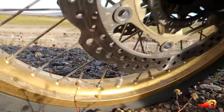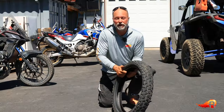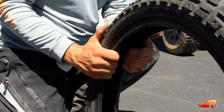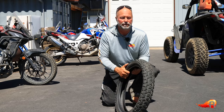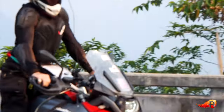One other type of flat we've seen is a little hard to detect. If you can't figure out what else is causing flats, take the time to flex open that tire and look for possible cracks on the inside, which can happen due to a manufacturer's defect, an old dry tire that needs replacing, or maybe you just hit something hard enough to create an actual crack. That little crack, every time it's opening and flexing up against the tube, is going to chisel and chew away through the tube and cause your leak.